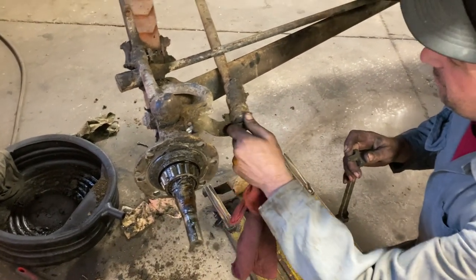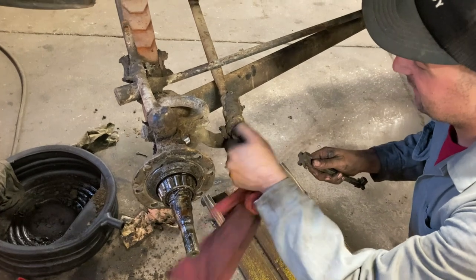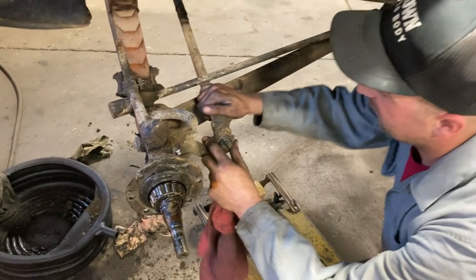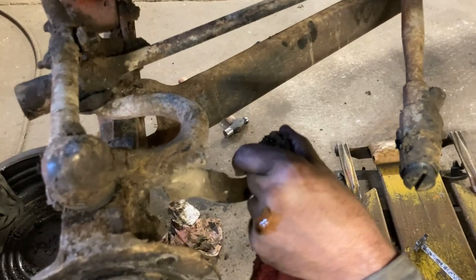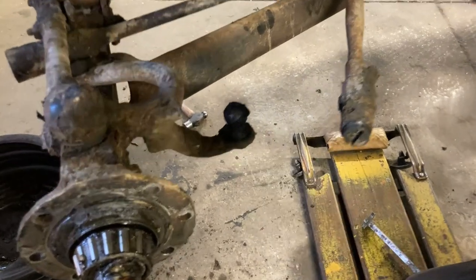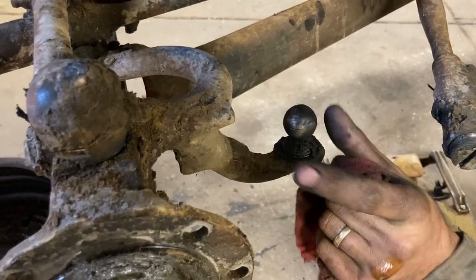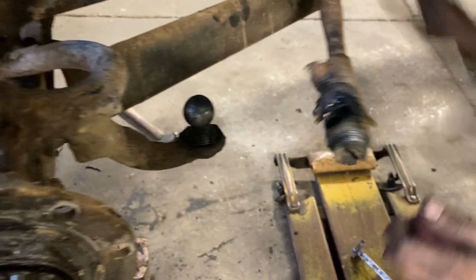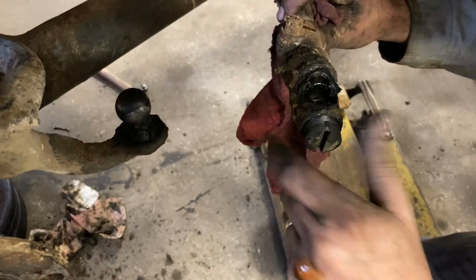A lot of this stuff I don't think has ever been apart, which is pretty cool — so we're the first foray into losing all the pieces. You just loosen it and then it pops right out. As you can see, it's a bit dirty. This is a grease seal — it goes on first. Then this ball here rides on this tie rod ball. It's in good shape; sometimes they get flat — the more you tighten them, the more they're flat. In here there's a ball socket with a plate and a spring behind it that just has tension, so you tighten against it.